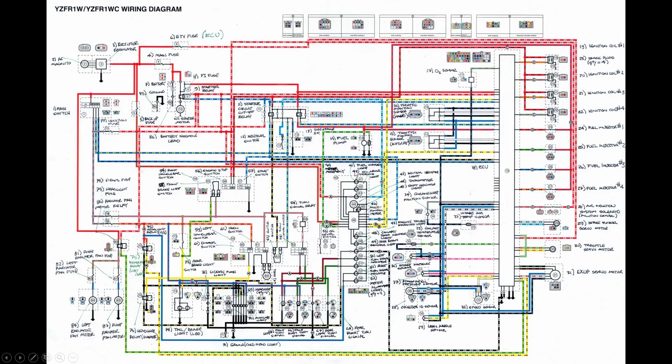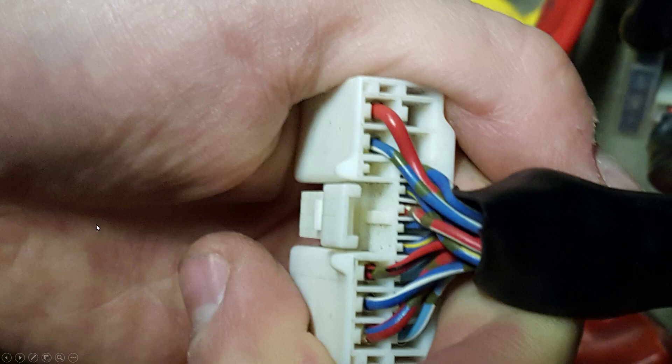I did not have a gauge at the time. Once I got the gauge in, it was missing the wires that go from the different circuits directly to the gauge, so I had to find all those wires and manually solder them into the gauge pins at the back. The bike did come with an ECU, so I did not have to mess with that at all, at least. Here I'm taking a picture of the plugs and referencing it with the diagram to make sure I'm cutting into the right wires.